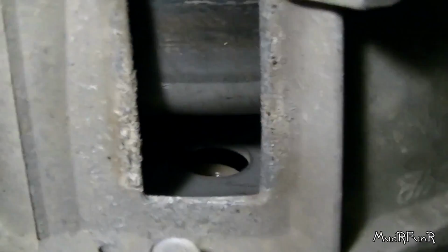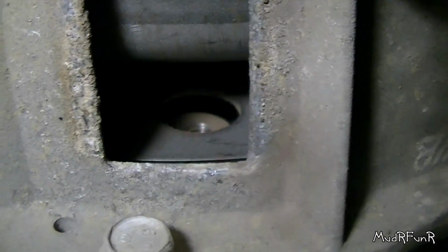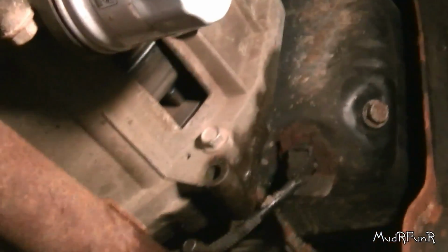Here's your transmission filter. Probably want to bring a little screwdriver with you. And just back behind that filter is an inspection plate. I think it just pops off of there. And there she be. This is where the LLY tool would come in, but like I said, I'm not going to be using it. Okay, so at this point it's very important that you have both batteries disconnected.